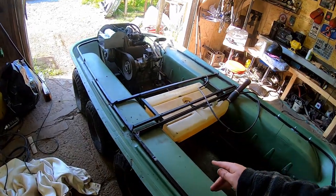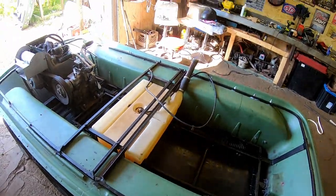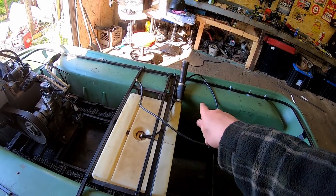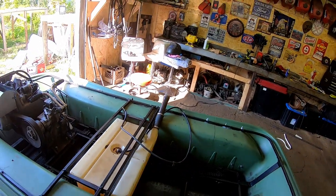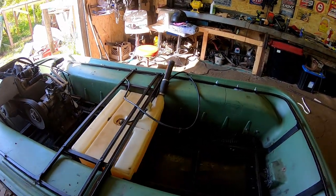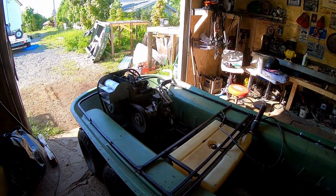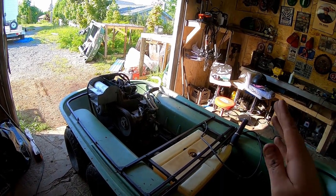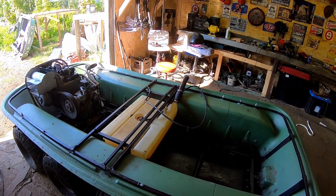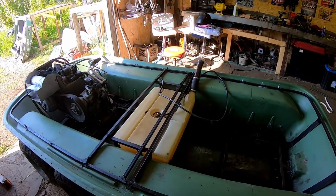The seat conversion setup is in here. I have the seat frame mounts welded and bolted on — I couldn't do really nice welds because I'm trying not to burn the plastic tub. It's not going anywhere: down below is welded on really well, bolted on with four bolts, and also bolted to the main cross member. The weight now rests on the frame as opposed to the factory setup on this '84 model. I'm going to strap the gas tank into the frame as well.